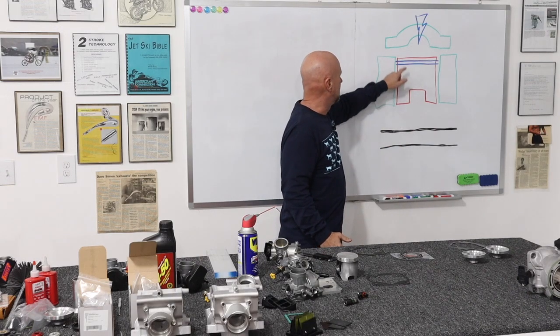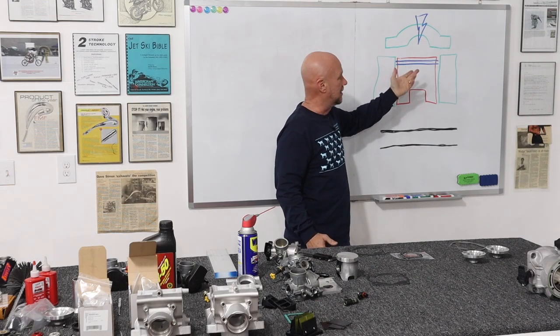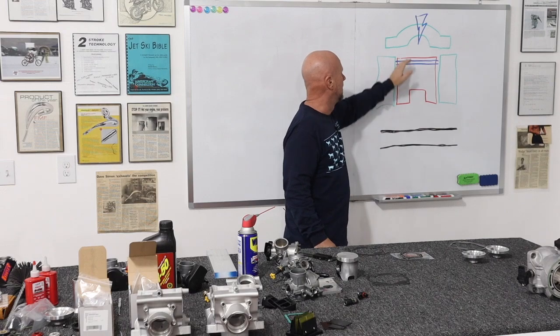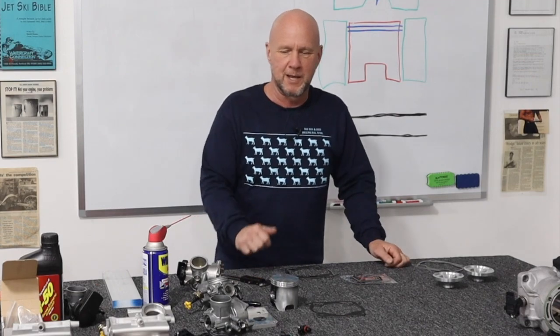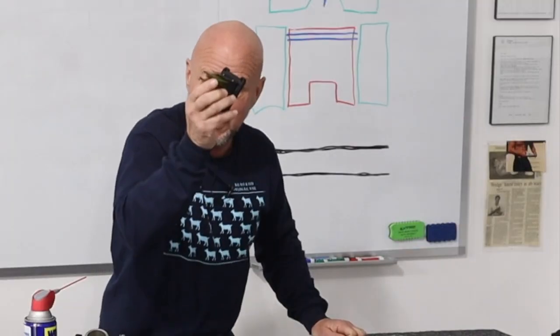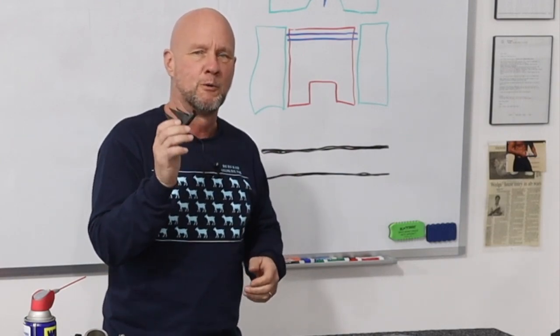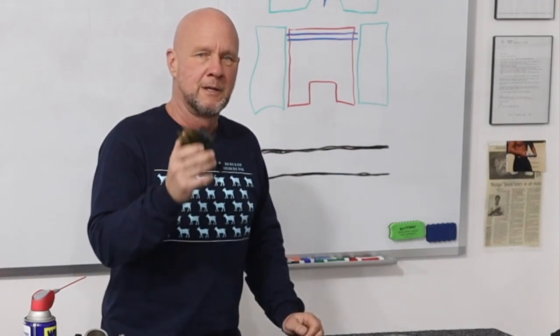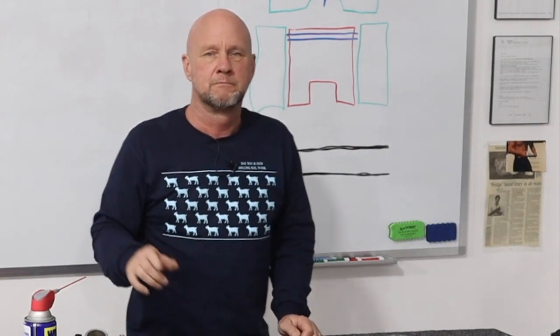I think you're good. Base gaskets, pistons, squish band clearance — that's the top of the piston to the top of the head, just in case you didn't know. There are your two rings, there's the spark plug. It's simple. Thanks for watching, I hope you have a real nice day. Next, I have eight sets of new reeds that came in from my friend who works at the Mercury Outboard Racing place — lots of them to try on this bike. I think I've got it narrowed down, but we're going to see what it does.